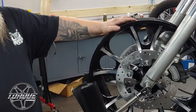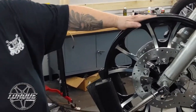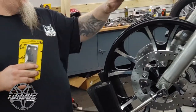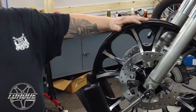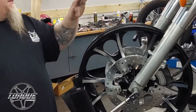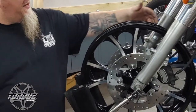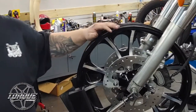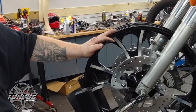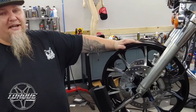The last part of the step — once I have this tire installed, I am installing the fender lift kit here to make sure with the 21-inch that the fender's going to clear without any rubbing. Even with the lift kit installed, when the tire's on I'll put this fender on and make sure I have proper clearance all the way around — back side of the fender, top, and any of the common points where a 21 will rub. Then give her a good test ride and have a little fun.